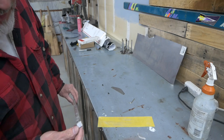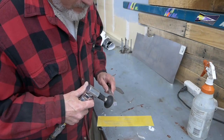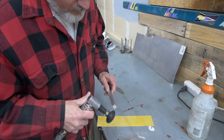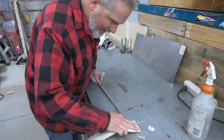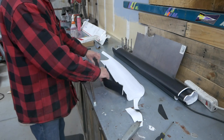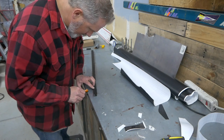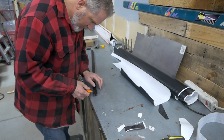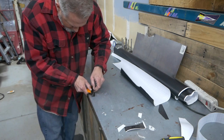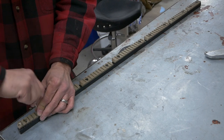Then I cut box ends out of the scrap aluminum to cap off the ends of the channel rail so it's a complete bar with no hole in the end, and used aluminum adhesive to adhere them on — which is plenty strong enough. I pulled the whole thing apart, sanded and cleaned down the aluminum, and cut my carbon fiber vinyl to overlap the aluminum with just a little extra so I could lap it underneath the channel rail and seal it off so it doesn't come loose. I worked the bubbles out with a squeegee, did the same to the mount so it matched the bar, then reassembled the entire Bronco bar and painted all the hardware gloss black.